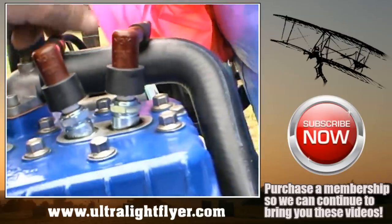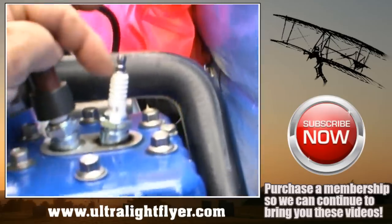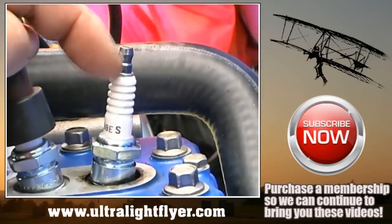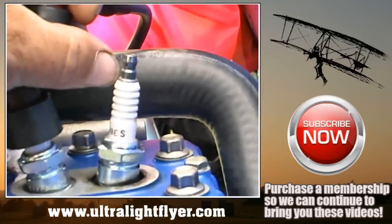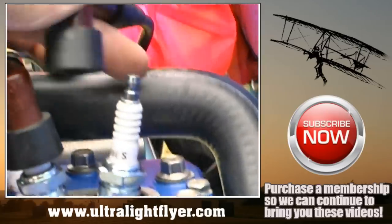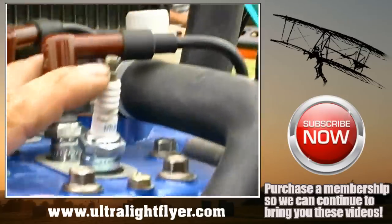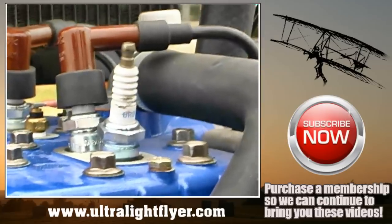These are the spark plug caps. These caps should be very difficult to remove. This is the wrong style of spark plug — this cap has an aluminum head on it, and it is already starting to wear. When it wears, it makes a loose fit. The type of spark plug you want has a steel cap — they are a little more expensive but they don't wear and the cap stays on. The correct plug has a steel cap that is part of the spark plug and does not wear like the aluminum caps do.